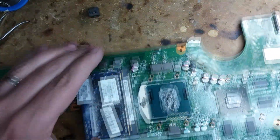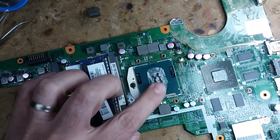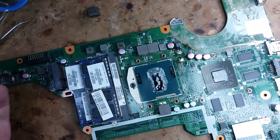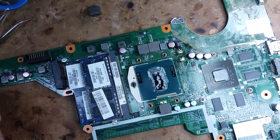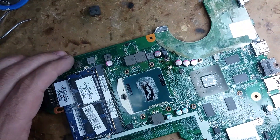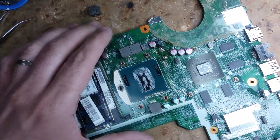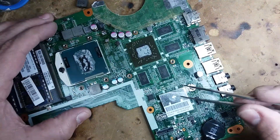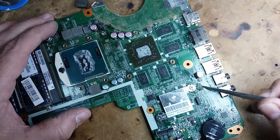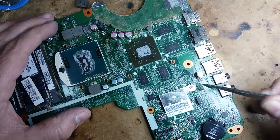Okay guys, I know this type of repair ain't pretty, but it does the job. So this thermal paste we're going to have to take out — it's really dry. After that, we're going to clean the heatsink and everything. The only thing to do now is to change the little resistor. The one I spoke about is down over here by this chipset — on the R550, you're going to change it to the R549.